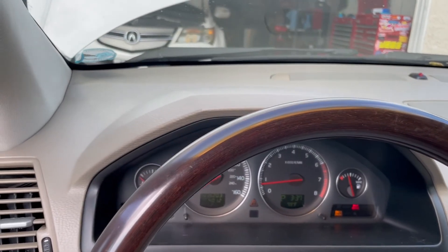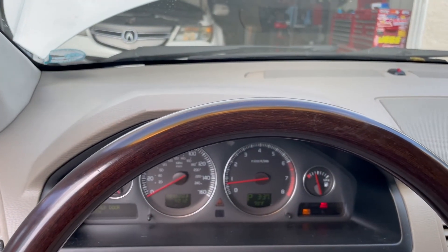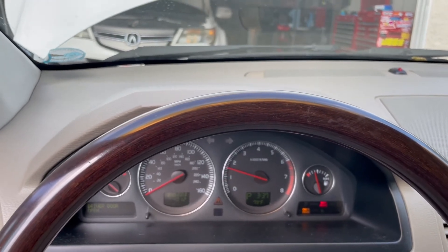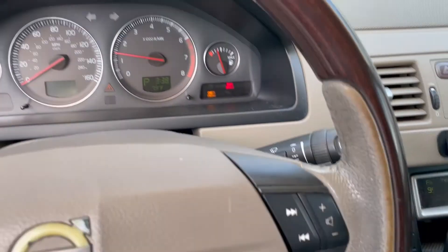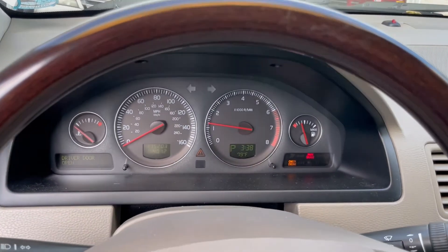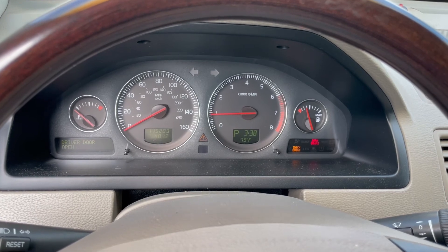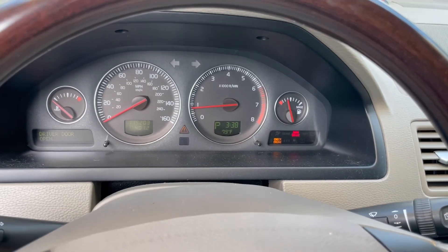You hear the motor's not liking the new mass airflow sensor — you just got to give the computer some time to adjust. Nothing's on the gas, nothing's being pushed; we're just letting the computer adapt to the new mass airflow sensor. Alright, looks like it's figured it out. I'm going to go ahead and clear the check engine light and it should not come back because that should have been our issue.